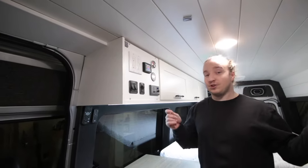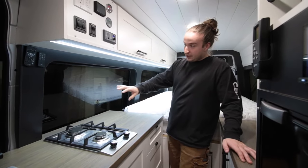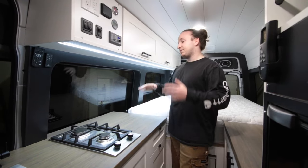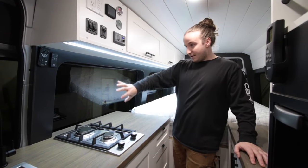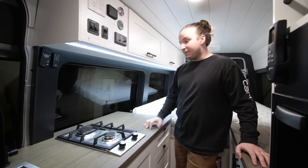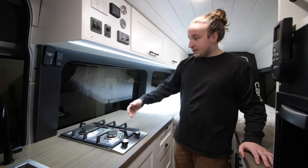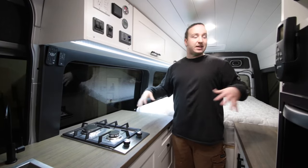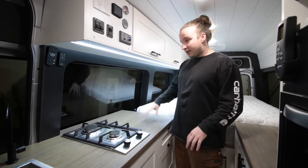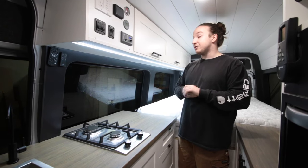I'll point out these little patches here — this is temporary for their curtains. They're currently getting all their custom covers made. Before we get into the overhead cabinets, I'd like to quickly mention the trim pieces. This is a passenger van — they come factory with windows. Clients wanted all the windows left exposed with some window coverings that have yet to be made. The trim pieces took a lot of time but we're really happy with how they turned out. We made some nice contour black trim pieces and kept in mind that windows have to be replaceable — these are easily removable with no visible fasteners. We went the extra mile with those.